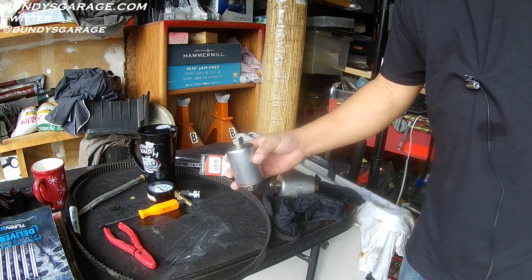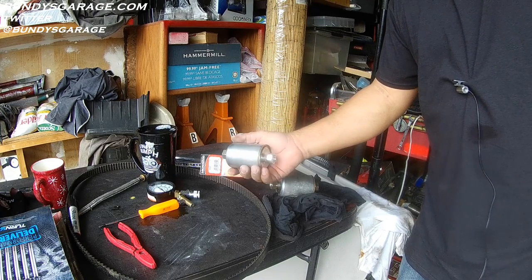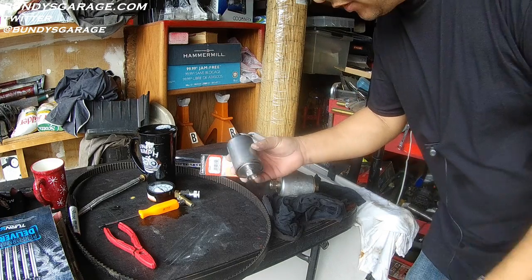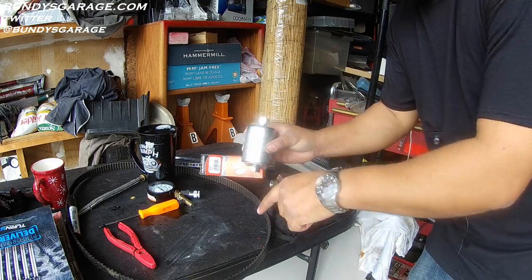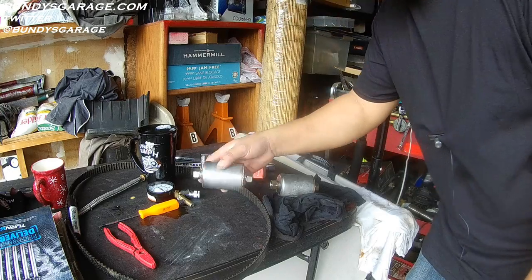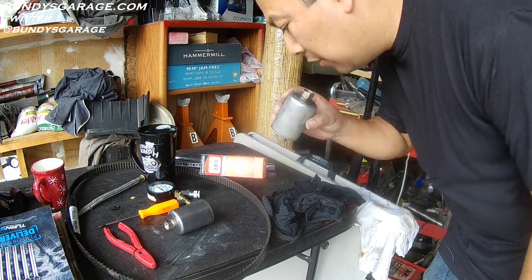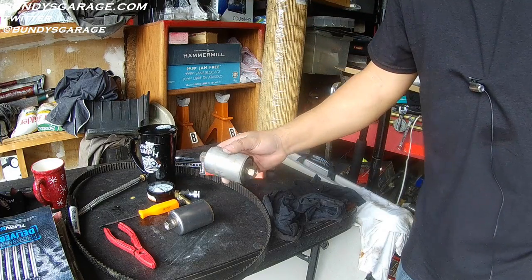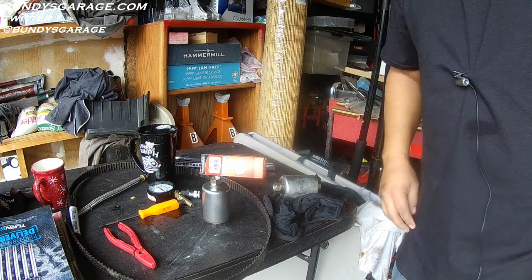So I know it's kind of crude and a weird way to do it — you're going to get fuel in your mouth and it doesn't taste the best — but what you do is: right here you have the outlet, this is where the gas comes in and goes out. Go ahead and use your mouth to blow on it. You want it to be nice with no resistance. Here's the old one — there's a little bit more resistance blowing through the used one than the new one. That's how you check a fuel filter for a gas engine.